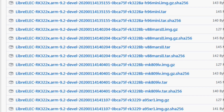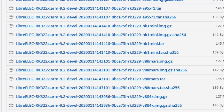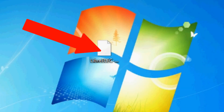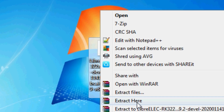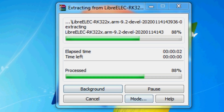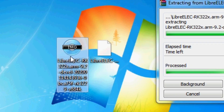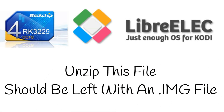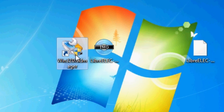Let's download the V88-4K.image.gz file and go from there. This file is a .gz file — it's basically a compressed zip file, so we need to unzip it. You can use any tool; I'm going to use 7-Zip. You can also use WinRAR — just right-click and go to the unzip option on the menu. Unzip it and you should be left with a .image file. Next, grab an SD card and burn or write the image onto it.